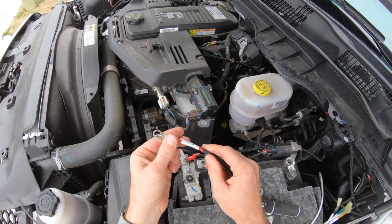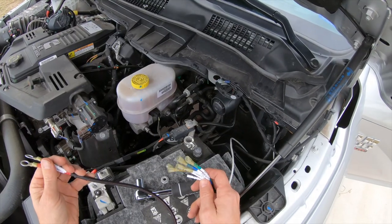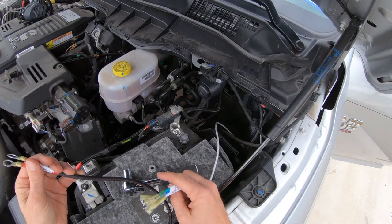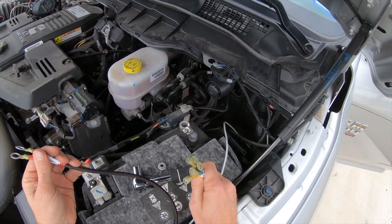Both your 12-volt wires go to the hot side of this battery — that's going to power all your auxiliary switches. Auxiliary one and two do not require the key to be on to operate, so you hook one and two up, hit the button, it functions. Three, four, and five — you have to have the key on or the accessory on to have them work.